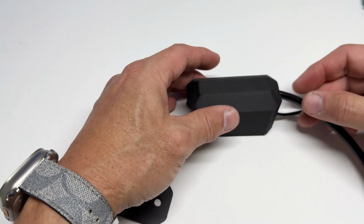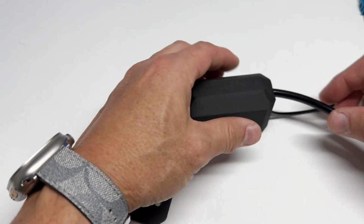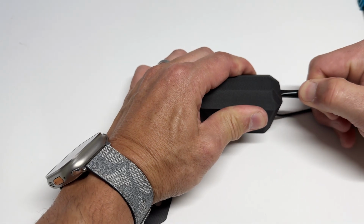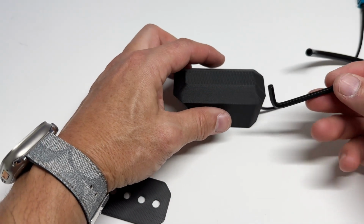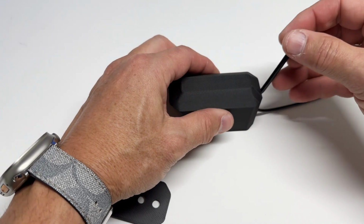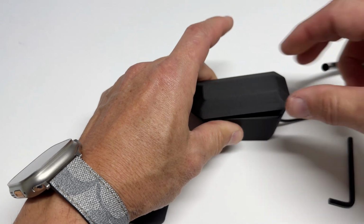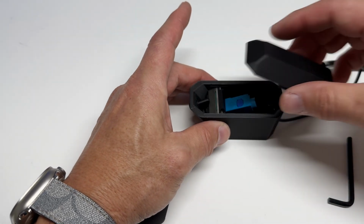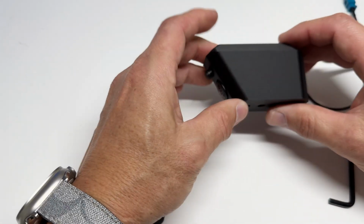So let's say you need to get this open, you're measuring, trying different mounting points, whatever. To get the housing open, you're going to pull out the washer hose, and then take a little hex L key, like 1/8 of an inch or something, put it in and use that to pop the top off there, and then you're good to go. There you go.